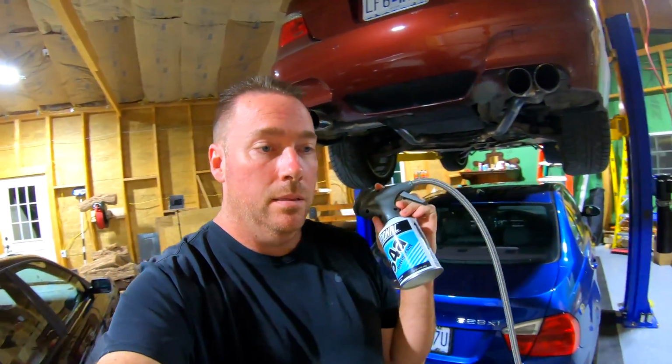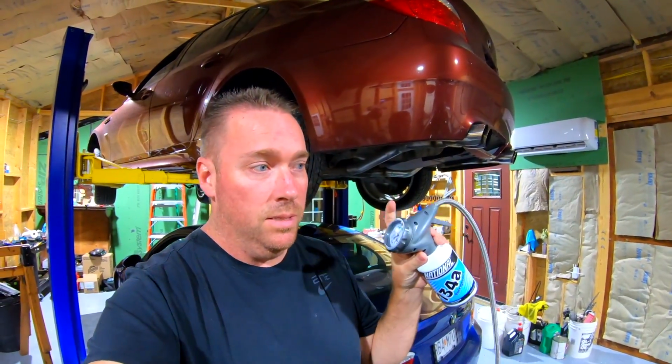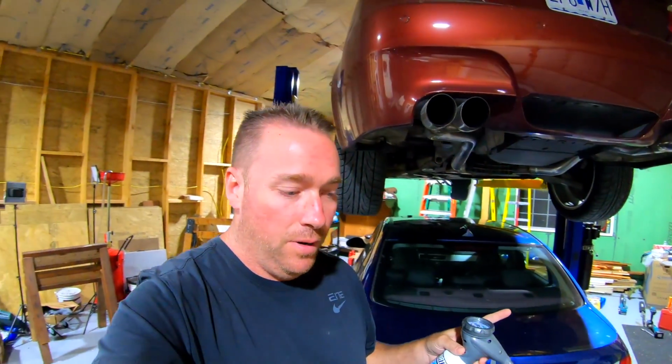And I want to talk about 2013 and newer vehicles that have the 1234YF refrigerant. So it just takes a different hose. That's the only difference, right? The hose looks the same. I'll also link that one up to it. I think they're $20 some. Make sure you don't buy the wrong one, right? Buy the one for 134A and not the one for the newer version. Unless you have a 2013 or newer, and then you need to verify that your specific car has the newer Freon, right?